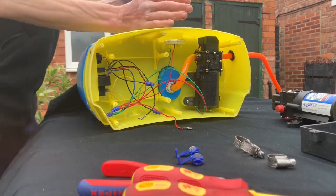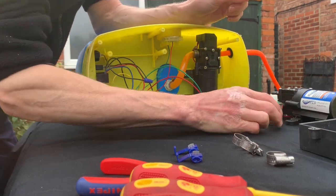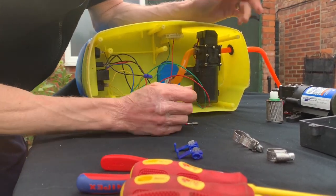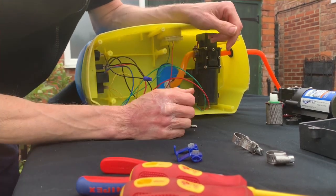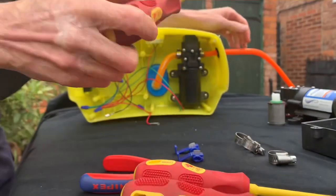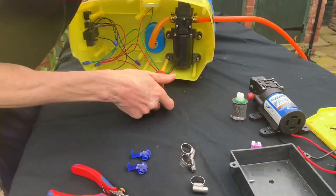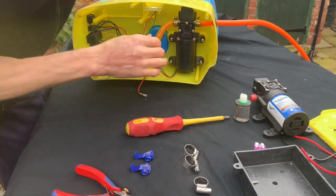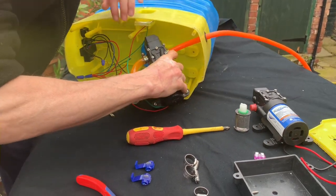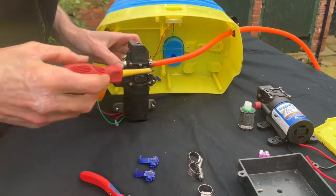You'll find that's the filter with a thread on it - it's got a little rubber ring there. This here will just come away, which makes it a lot easier to take the pump off. So the first thing I do is use the Phillips screwdriver and take the little screws off the rubber feet. Now the pump's nice and free, it's a lot easier to undo the Phillips screws on the actual jubilee clips of the pump.